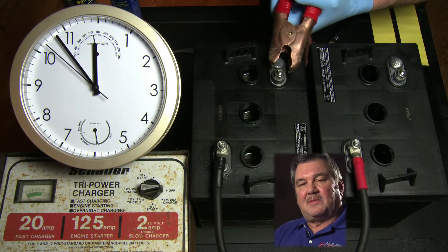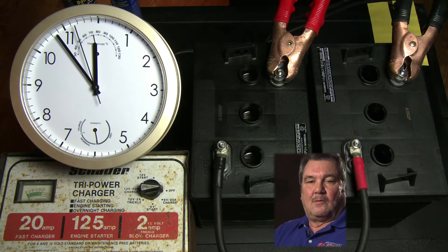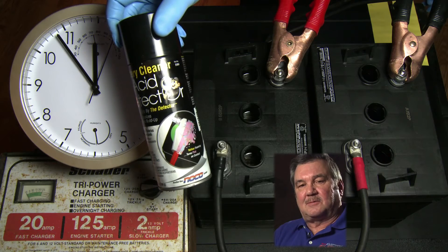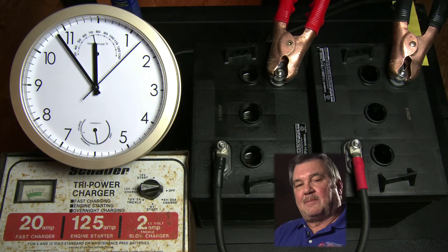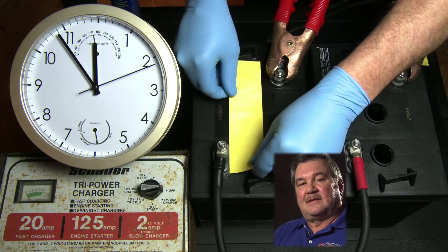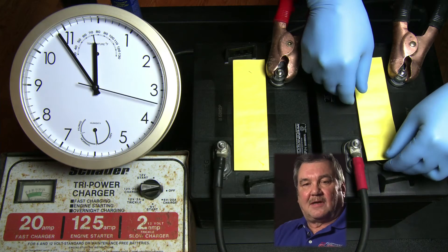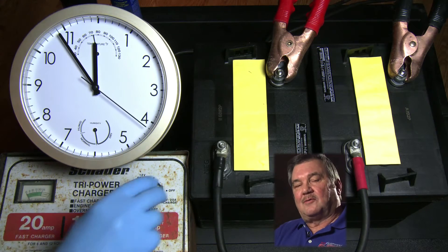The results would be exactly the same if the caps are left on — it will just take a little while longer. Once the battery has been treated with Battery Demister, I use plain paper that has been treated with acid detection spray and place it over the vent tubes on both batteries. The paper will turn purple when it comes in contact with any sulfuric acid that escapes from the battery during charging. You can do this yourself with a regular piece of paper, but instead of turning purple, it will just get wet. The batteries are now put on a 20-amp charge.